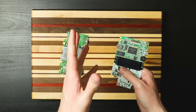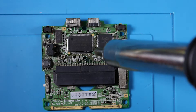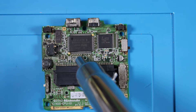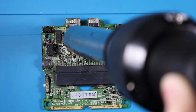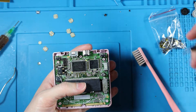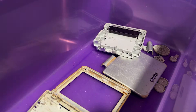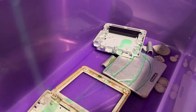I also had to do other things to that rusty SP — I had to reflow all of the solder on it. I swapped every button, the charge port, the link port, the battery connector. I put flux across the entire board and heated it up with my soldering iron. I think I even swapped the cart slot on that thing too, and I still had to connect a bodge wire or two to finally fix it. But it is working — it's going to be my personal SP. I cleaned up the shell but kept it. It looks gross, but I love it.